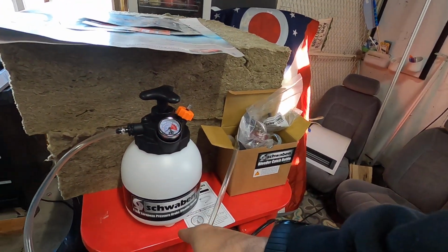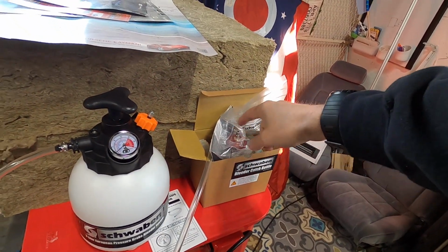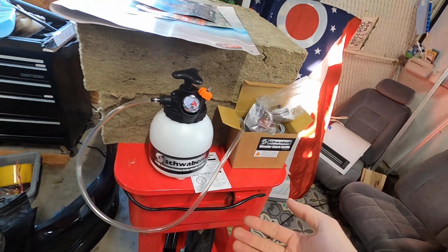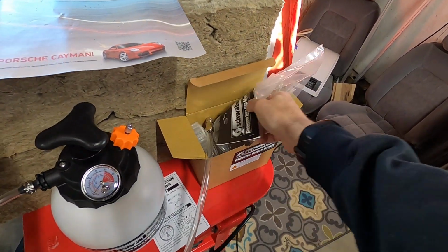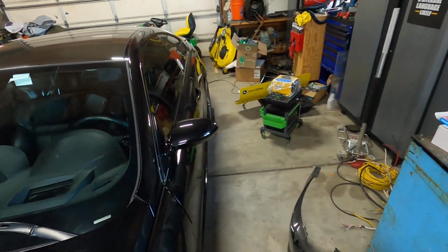Really happy about that. Another thing, I got a brake bleeder system that's pressurized. So you pump it up. It's got the little adapter you put on the reservoir, and you can one man band these things because all my friends are here to help me with these sort of things. It's fine. It wasn't that bad of a cost, but it's not zero. It's like $100 because you have to buy the extra, a secondary catch bottle in there. So that'll all be awesome.